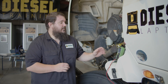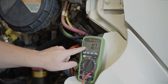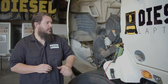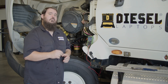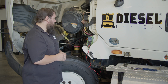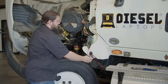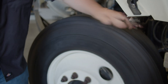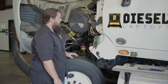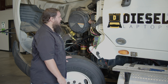Now I need to turn my multimeter to voltage AC. When I turn my multimeter to voltage AC and start to spin this wheel, I should see roughly one quarter of a volt for every two revolutions per second. I'm going to begin by spinning the tire slowly and monitor that I'm actually seeing the change. Right now I'm at about 160 to 200 — roughly 250 millivolts, which is one quarter of a volt.